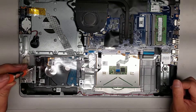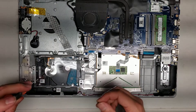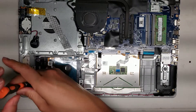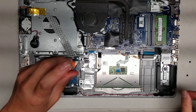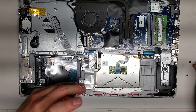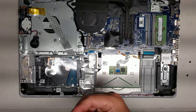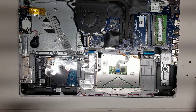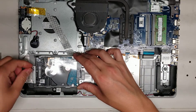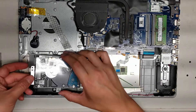So then there's the hard drive held in place by these four screws. The bracket is held down with four screws, and then the hard drive is held into that bracket with more screws. So I'm going to change the hard drive to an SSD now. Just remove the four screws from there. Make sure the screwdriver — if it's not getting a good grip — make sure to put a lot of pressure downwards. You don't want it to skip in the screw and strip it out.